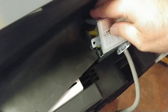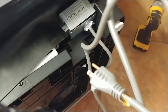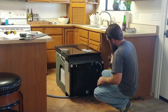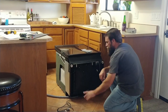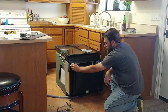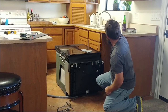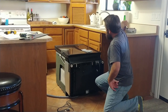Time for the cover. This is a pre-made cord — I bought this at my Ace Hardware; you can get them at most hardware stores. It's eight feet long so that it's long enough to reach. The cover plate is on. This unit has little clips here to secure the wire, keeping it tucked up underneath. Now it's a good idea to take a look at the leveling legs — how they work and where they are. Once we get this installed we'll be able to adjust these. This one has a little allen screw — a 9/64ths — and we can adjust the one in the back using an allen wrench.